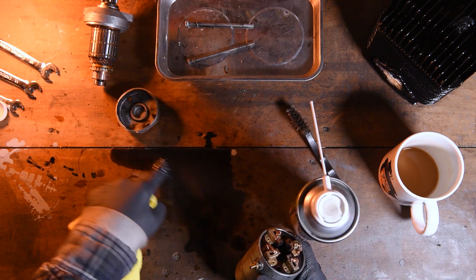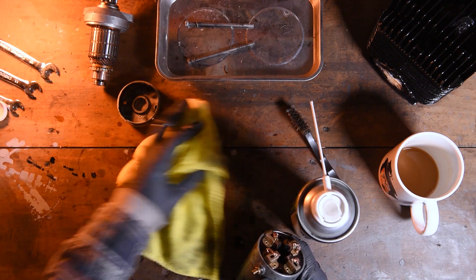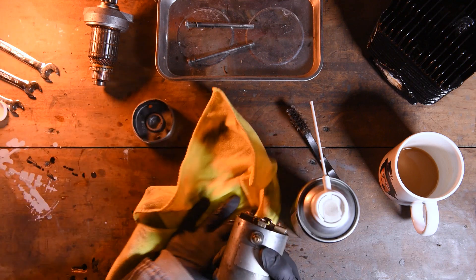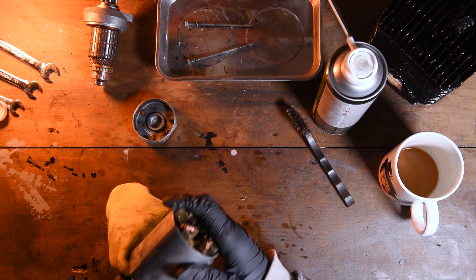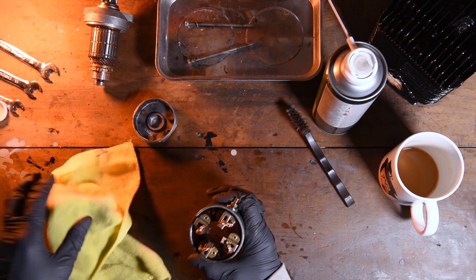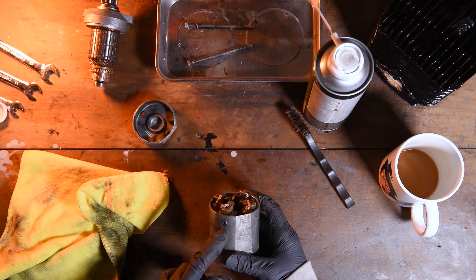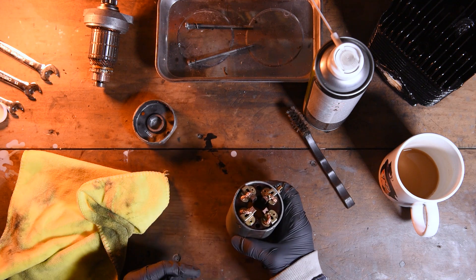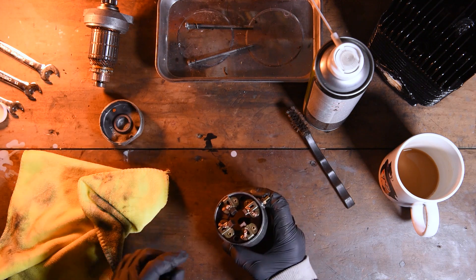As you can see this water is pretty black and dark from all the carbon. Obviously if you're doing this maintenance in your kitchen make sure you put down some newspaper before you start. Now all you'll need to do is get in there with a cloth and clean this out. Sometimes you'll be able to remove this plate with all the brushes on — mine's held in with a pop rivet so I'm not about to drill that out. I'm going to clean this up as best as I can, let it dry, and whilst it's doing that I'm going to clean this cap out and then we can put it all back together again.